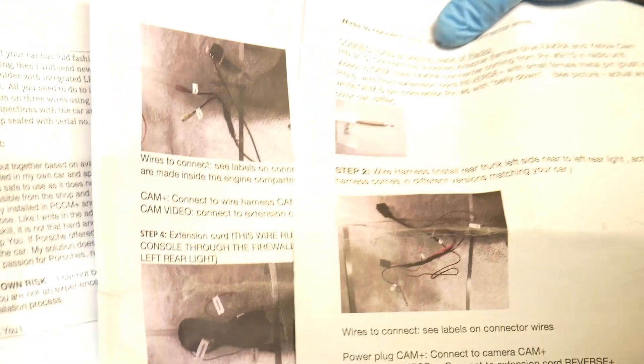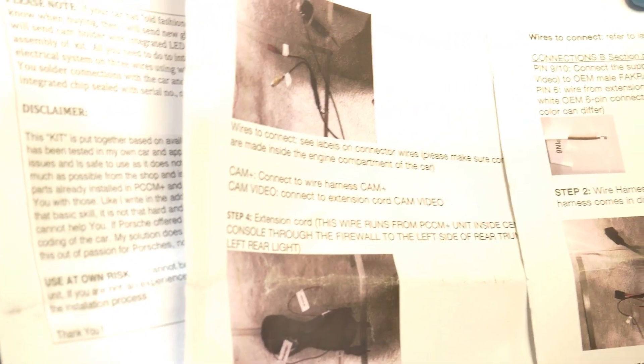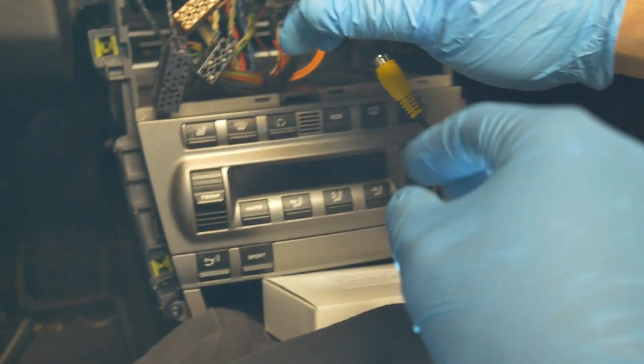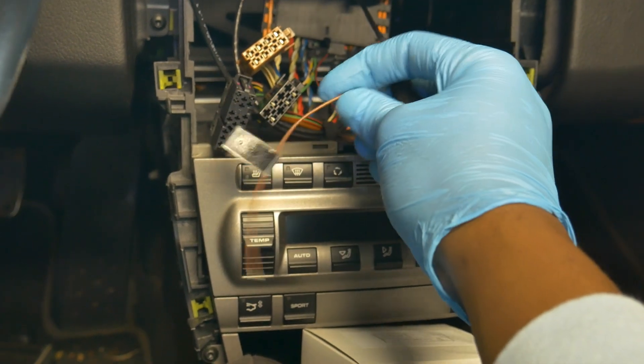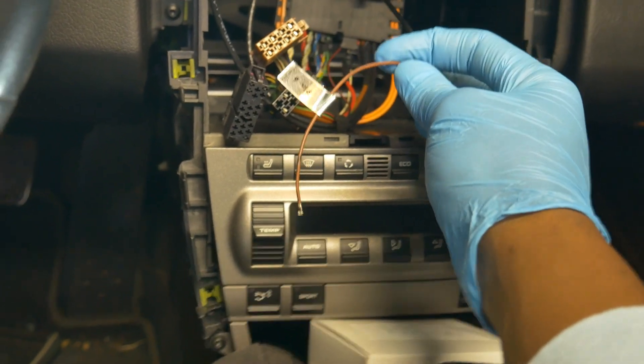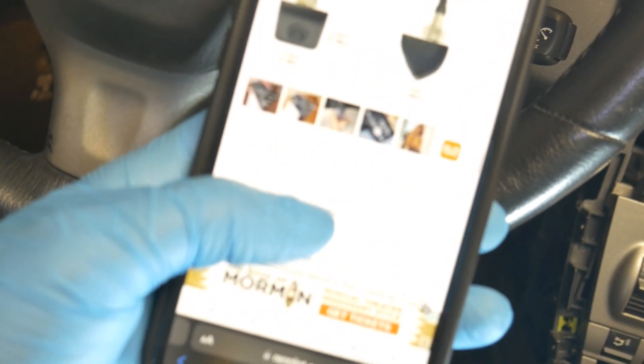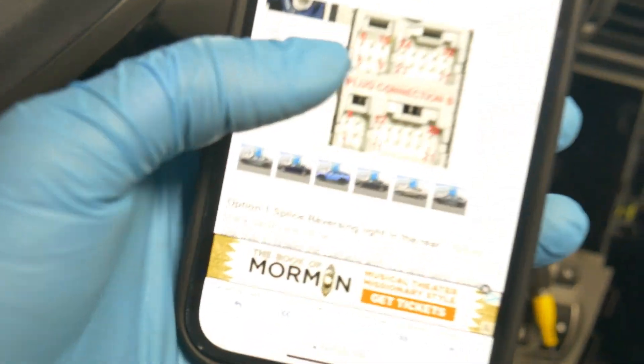Let's get this new one in — I really need some Apple CarPlay in my life. So the connector for the reverse camera needs to know when you're in reverse. In order to do this we have an extra pin — pin 6 — which is supposed to trigger the reverse signal. What we found online tells us exactly where that pin is supposed to go, and I'm going to share the link in the description below.